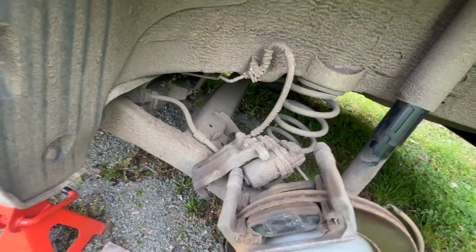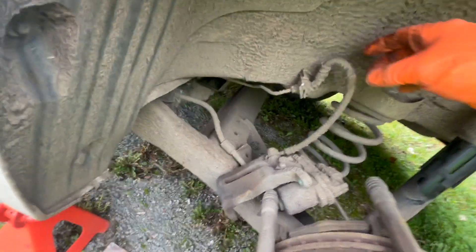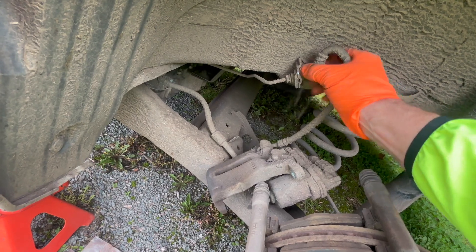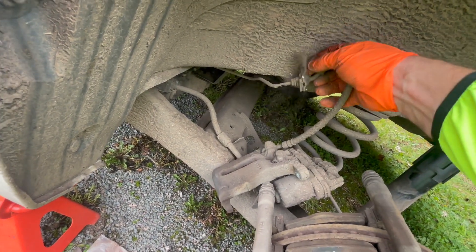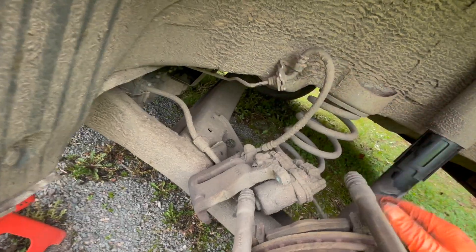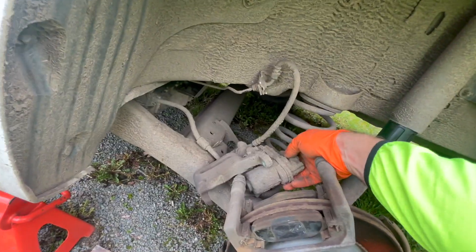I'm always telling customers about the state of their wheel arches because these brake line ferrules - the dirt that sits around them absorbs salt in winter and then attacks the ferrule itself. I always say to customers: fresh water, just wash it out, and that'll look after it. Generally I clean them and spray them with a bit of grease to protect them. I should heed my own advice there.